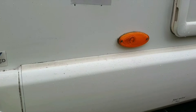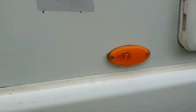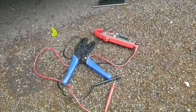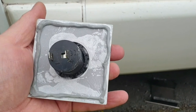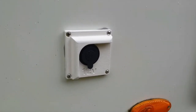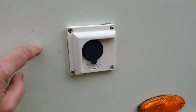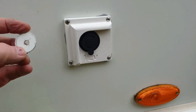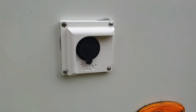The wiring is pulled through from underneath, right across the chassis at the bottom. Check for positive and negative with the meter — positive goes on to the center terminal. All screwed up now; the sealant is just beginning to squeeze out from around the back — trim that off later. Just be careful with the screws because the layer is very thin aluminium, or sometimes fiberglass, so don't over-tighten the screws or you'll strip the thread.